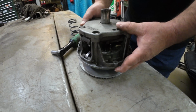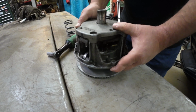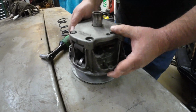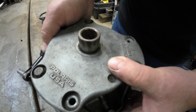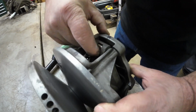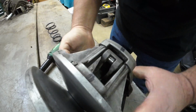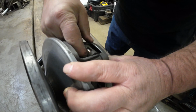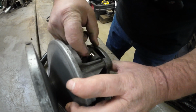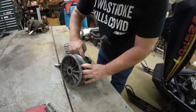Kind of worn on the buttons, but usable still. Bushings are, as you can see, pretty shot. It's basically doing a hula dance on there. All right, and then the rollers. Well, Tommy, that roller barely rolls. That bushing is wasted in that roller. That roller's loose, and there's no thrust washer on it. And that one's fairly good. So 2 out of 3 ain't bad.